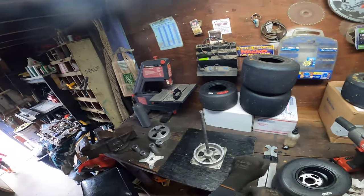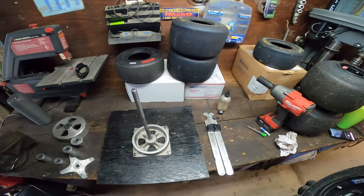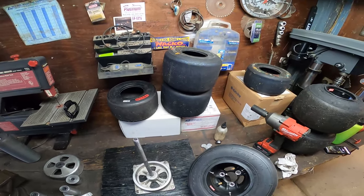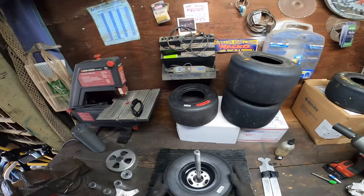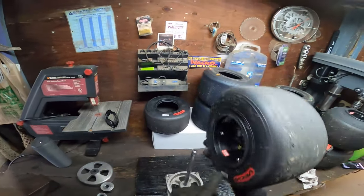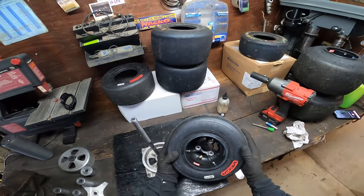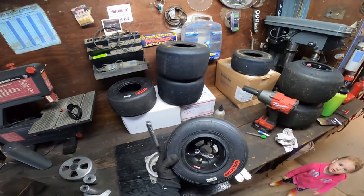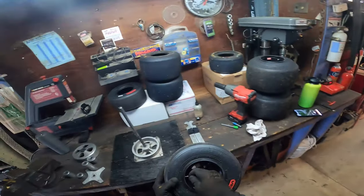This is the easiest way I found to change these tires — this is the turbo tire changer. You always put this on with the valve side down. The first thing we're gonna do is break the bead. I've already backed out these bead lock screws — make sure you back them out far enough so that they don't strip out or fold over on the inside and wreck the rim.